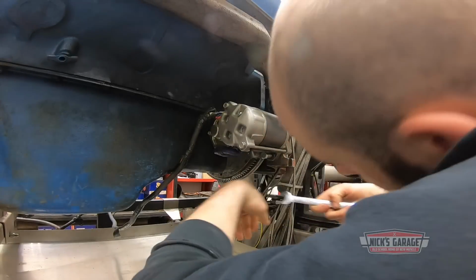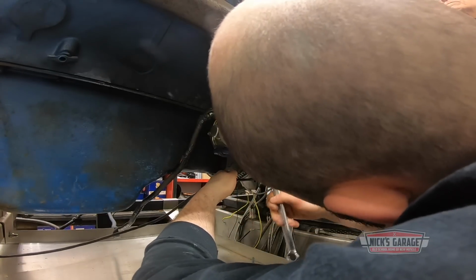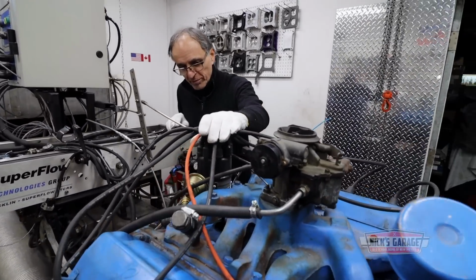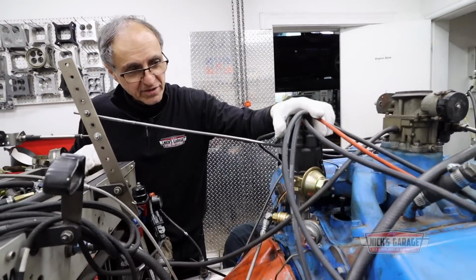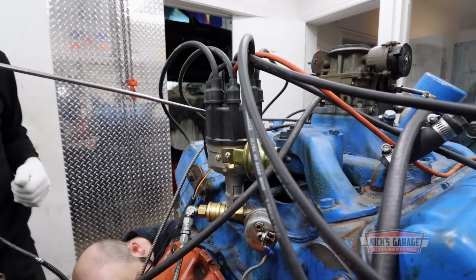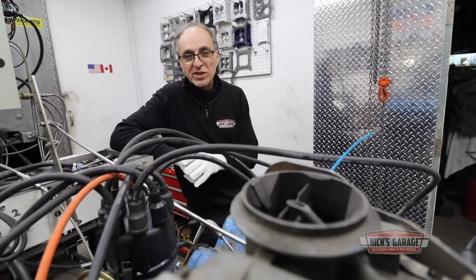I was very lucky on the first starter, on the first engine, but this one just seemed to be a problem. And of course, look, he brought me in a rough distributor, so I took a 340 electronic distributor, which bolts right on. Look at it, electronic ignition, from an A engine. Bolts right into a 1954 Dodge. Check it out, eh? Some things never change.